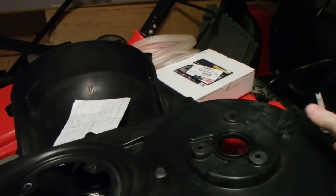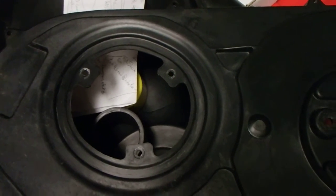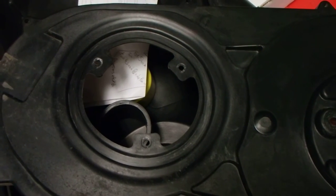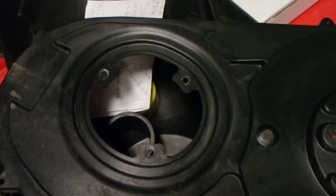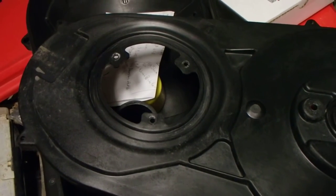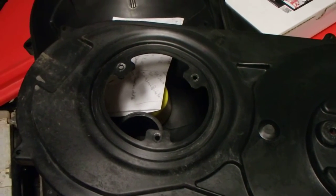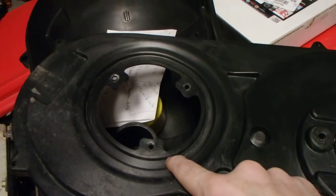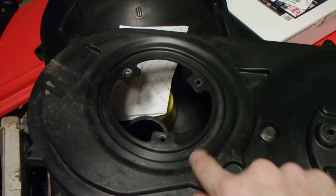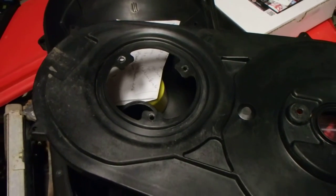How do you take care of that? I talked to Polaris and the shop manual says for the engine side, use blue RTV. Polaris told me blue RTV is what's preferred, and if you've ever had this cover off, you've seen blue RTV all around here — maybe not even a good job. I used a citrus cleaner, sat in front of the TV for about 30 minutes scratching and picking at it with different tools and picks, trying not to score up the plastic, but eventually getting it all out — real clean.